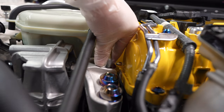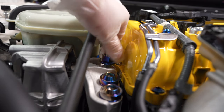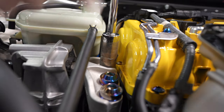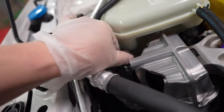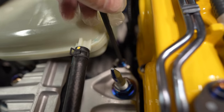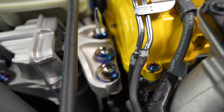Thank you Jay for coming through again. This is the number 19 deep socket I needed — works like a charm. They supply a titanium washer and nut. This one is also 74 foot pounds. The Chasing Jays nut is a 21mm versus the factory 19mm. The two bracket bolts are a 14mm torqued to 41 foot pounds. Last but not least, the ground nut is a number 5 Allen. Done — looks absolutely amazing. Can't say enough about Chasing Jays.